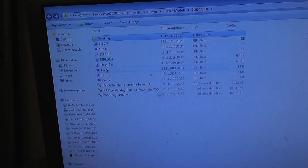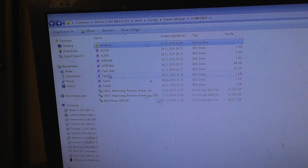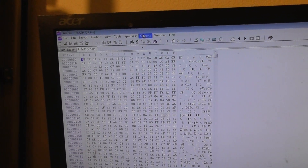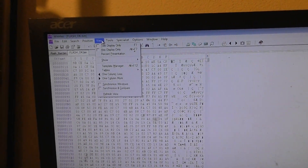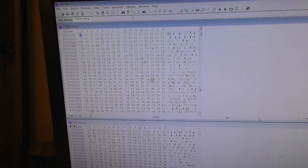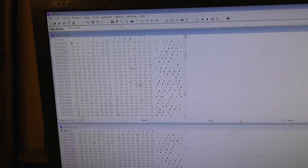Just for kicks, I want to know why the module didn't work. Now I have the contents of a good module, a good Motorola, and from the bad one — let's compare. Here I have all the hex files that I read out of this Motorola. The main program is in the flash. Flash bad is from the non-working module and flash ok is from the scrapyard module. I am using WinHex to do this — go to View, Synchronize and Compare. Both files are synchronized and I am scrolling down through the whole code to see if I find a difference.